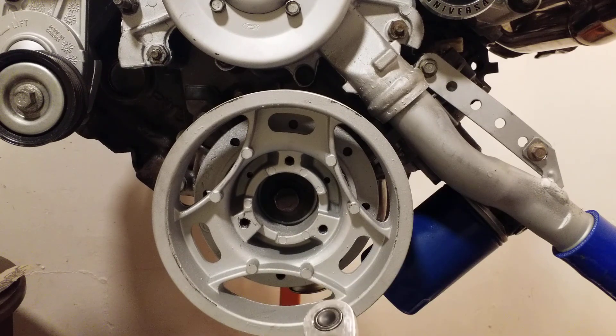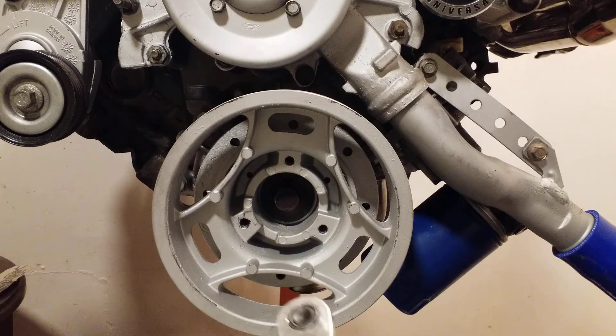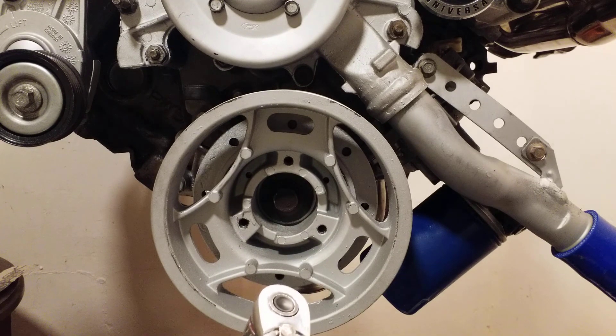The big deal is that in your Mustang between 1994 and 2004 they had three different designs of balancer: the first being a two-piece design, the second being a one-piece design, and then the 2001-plus being the neutrally weighted — basically an easy exchange where you can just swap these guys out. When you're swapping your 2001, it's going to be the easiest because it's just a direct swap — you do the procedure and swap on the Freestar balancer and it's done.